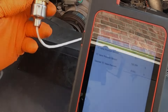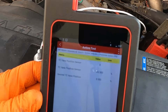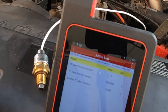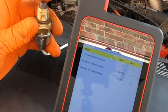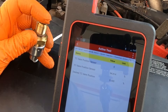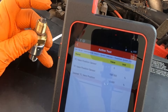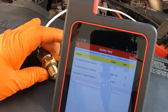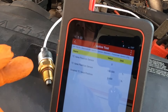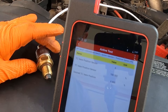I've got my new vane position sensor plugged in and I've pulled up the live data. Look at that — the desired is zero, and the sensor is currently reading 100%. It's fully out. Now watch what happens as I push it in — going down all the way to zero. When you let go of it, it goes all the way back to 100. The original sensor, the one that's supposedly bad, only went up to 21%. So this new one is good.